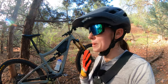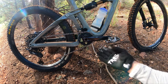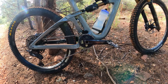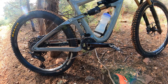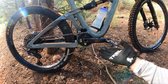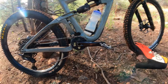That was a cool and very fun experiment. I can definitely see why people like the mullet thing. Now the bottom bracket is a little bit lower with this setup. Honestly, I don't know if I was picking up on it in the cornering, but I definitely felt it sometimes climbing ledgier stuff — felt like I was going to clip a pedal a lot sooner. If I was going to do this configuration, I'd probably put shorter cranks on it. That said, the lower bottom bracket and potential pedal strikes weren't as bad as I thought, which is really saying something in Sedona. We're quite accustomed to a lot of half-ratchet work here anyway, so it was noticeable at times but not as big of a deal as I expected.